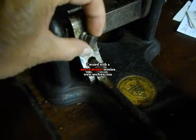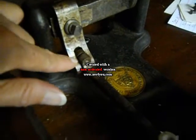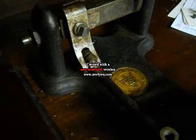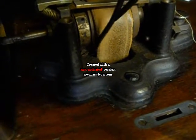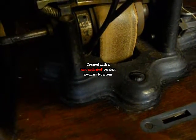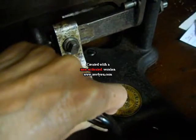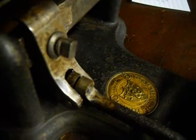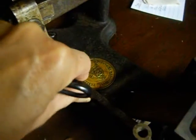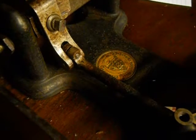The first thing I'm going to do is tighten these up and make sure they're tight. Then I will set this at a certain place — I'll leave it right where it is now — make sure that's tight if it's adjustable at all, and then tighten up this clamp and the clamp in the front and see what that gives me. Now this front clamp, which is right here, has a screw at the bottom of it. I was just able to turn that screw almost a complete rotation to the right, and as soon as I did that, look — there's almost no movement. I've almost prevented the side-to-side play that I had in this connection, just by tightening the one screw in the front.